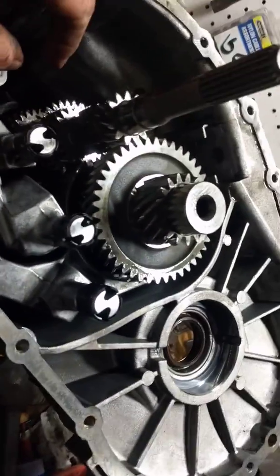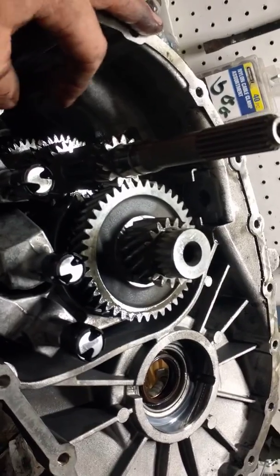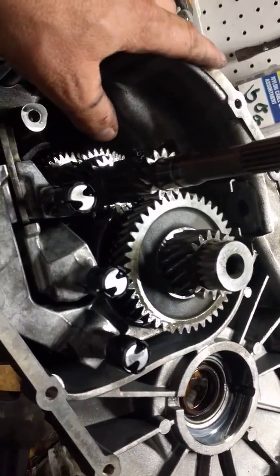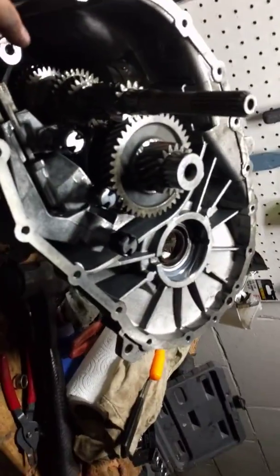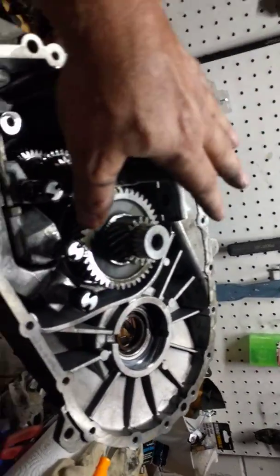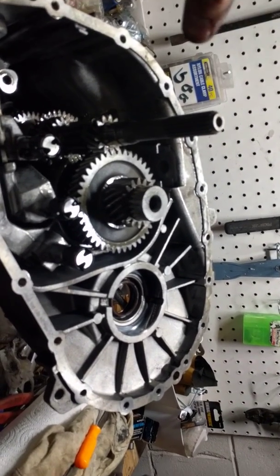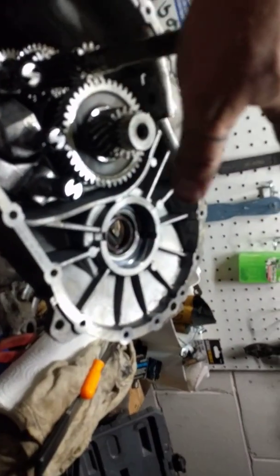This was making some bearing noise. I can tell it's not those bottom bearings, which are really hard to take out. Also, when you take this transmission apart, you want it in this orientation — bell housing up. It's designed to come apart this way; that's how all the bolts are. You don't even have to remove the bolts, as you can see they're all still happily in their respective places.